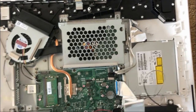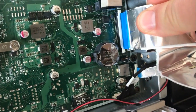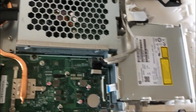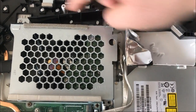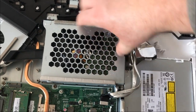Once you've got everything out and you pull the screen off, you can unplug the monitor by popping this little tab out. You'll have this little dangly cord here — just kind of set that aside. Just remember how you took it apart so you can put it back together. Now to take off the hard drive, you've got one, two, three screws you need to pop out, and then the whole thing will just lift right out.